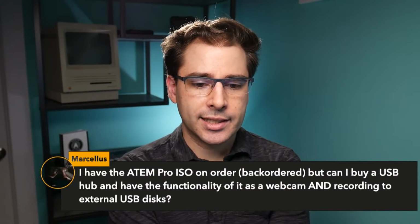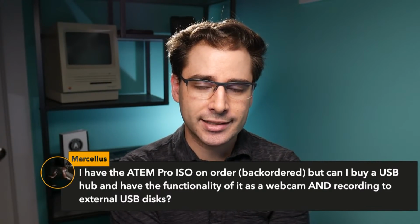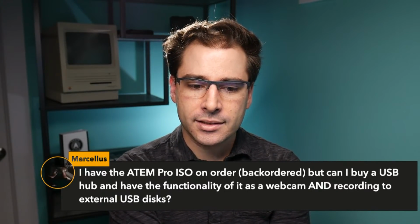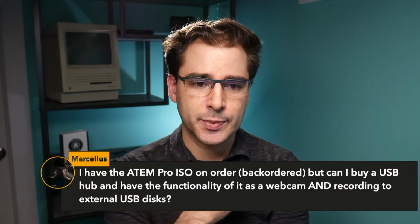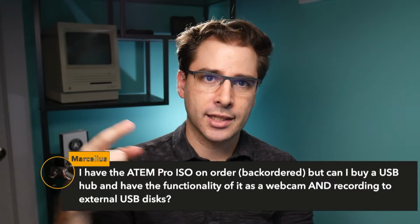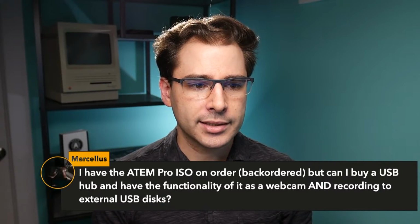Marcellus says, I have the ATEM Mini Pro ISO on order, back ordered, of course, because it's not shipped anywhere except Europe yet. Why do they get everything first? But yeah, a USB hub doesn't work for that. You can't have a USB hub and also use it as a webcam and recording to a drive, because the hub would have to work in two directions for that to work, which is not possible.